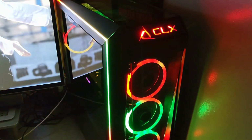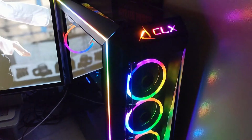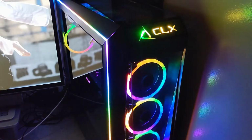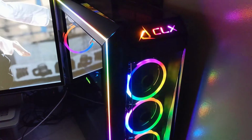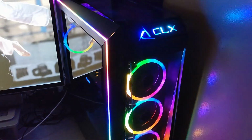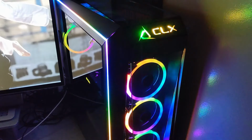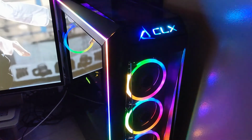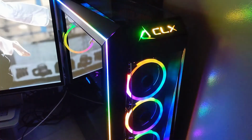I guess this thing has 57 different color options. But to be honest, that's one I like. So, takeaway, it's not too hard. If you have a spare RGB fan, a little bit of super glue, a lot of patience, and just a tiny bit of attention to detail on your wiring, you can switch this out. You know, take out that red panel. I don't even know what I did with the red panel. It's somewhere around here. Put in your strip lights, which you can break down, apparently, and just super glue them in place. Plug them in to make sure it works, and then put it all back together.